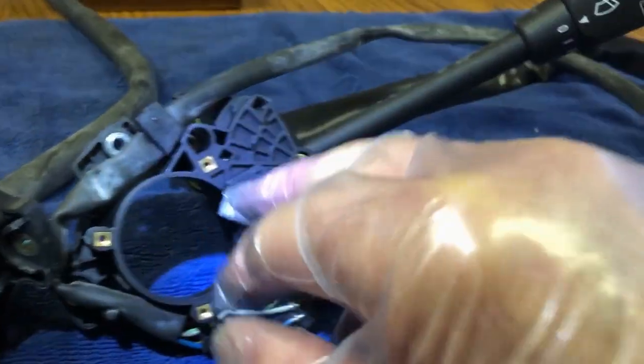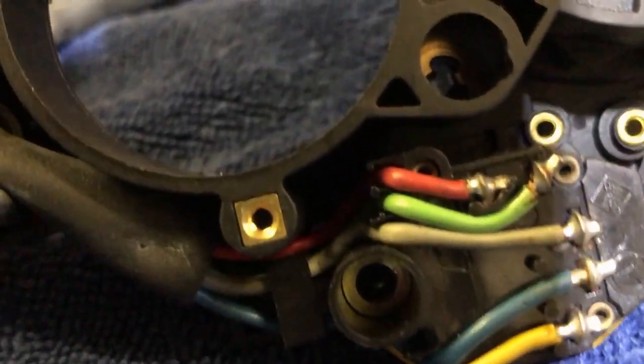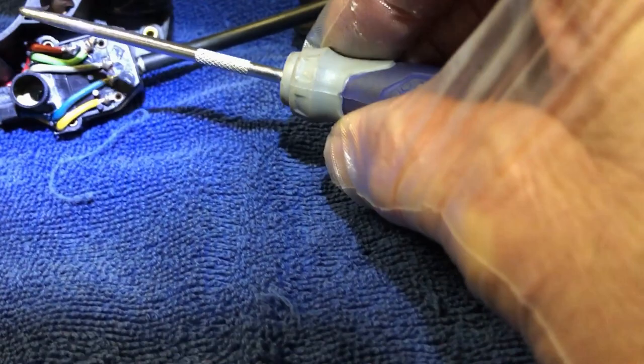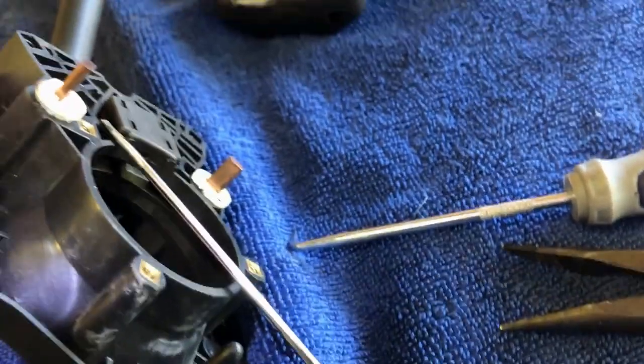Yeah, I've got to pry these things out real gently, and they're spring loaded. Transfer this to these guys right here. Okay, yeah, I can see, I think there's a slot, little slots here, so they only go one way. Okay, that's the way I'm doing it. Had that screwdriver, the same little screwdrivers, and just start prying it up. And it'll come out. It's tight. Don't break these or you're screwed. You won't have a horn. Switch to a bigger screwdriver.